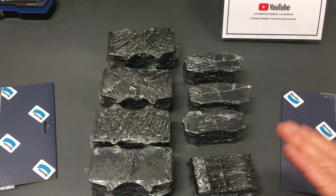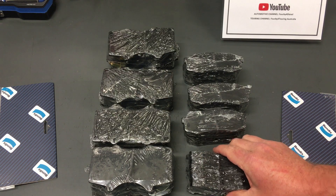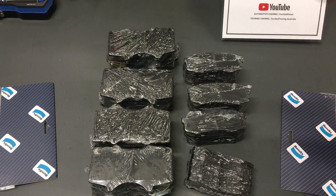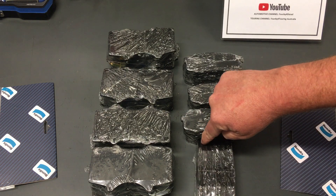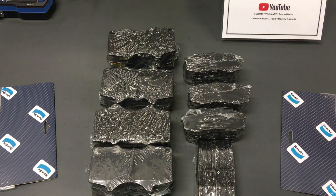And this is the other thing — bonus information. The rears, particularly on the DB1200s on the rear of the Prados, they always wear unevenly. Just about always — that means on an angle, so one end will have more than the other, and it happens on both sides of the car, sometimes on both sides of the caliper — the piston side or the outside.